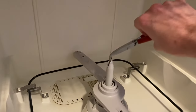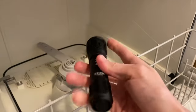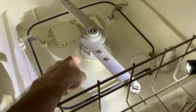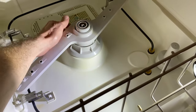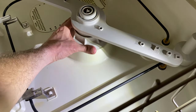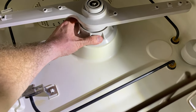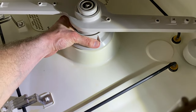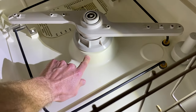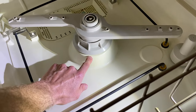I'll go ahead and lower that down, set the pliers down, and grab my flashlight here to give you more light. Inside here, all the water sprays out of these holes. In the event that the spray tower is loose, what you want to do is carefully tighten this bottom shaft portion here. In most cases, righty tighty, lefty loosey — and ours is extremely tight, so that's good. It creates a seal to alleviate water from sneaking through.